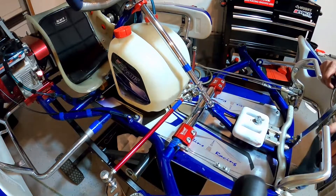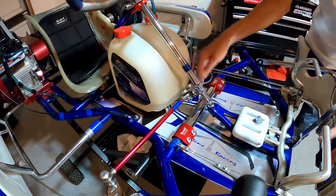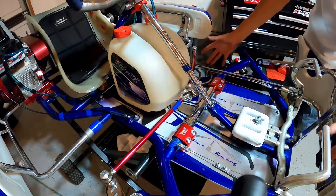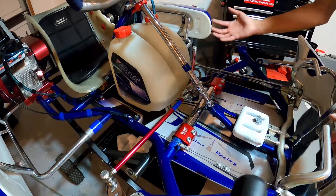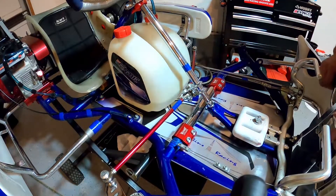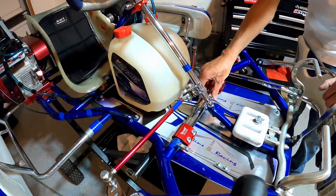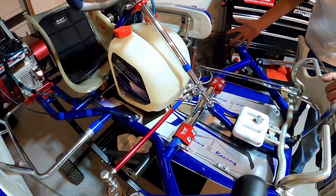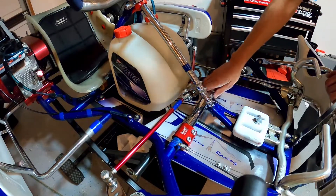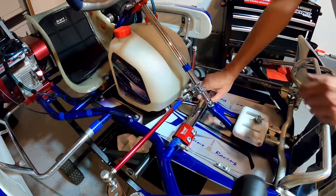This is going to affect the stiffness across the whole front end of your go-kart. If you throw a stiff bar in here, when your driver goes to turn and this front tire digs into the ground, it's going to allow this whole side of your chassis to lift up. When that lifts up, that's going to relieve weight off that rear tire and get you through the turns. Exact opposite with a soft bar — the driver turns, the tire digs in, and the bar flexes, preventing the weight from lifting off that rear wheel as much.